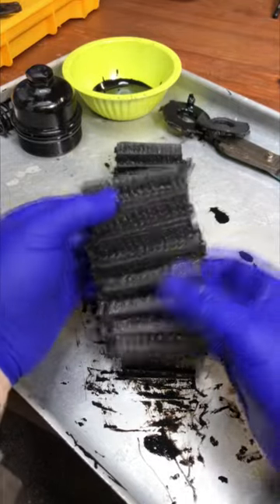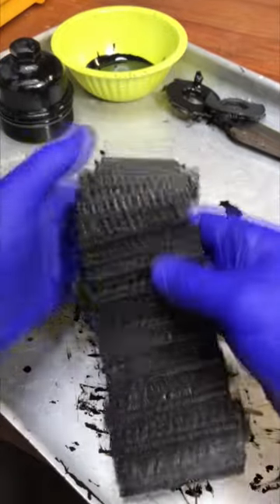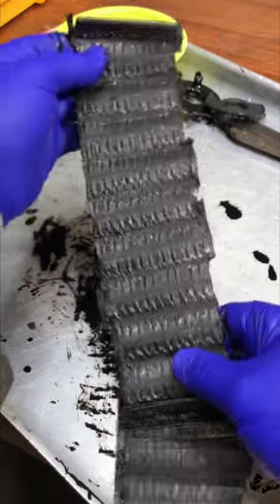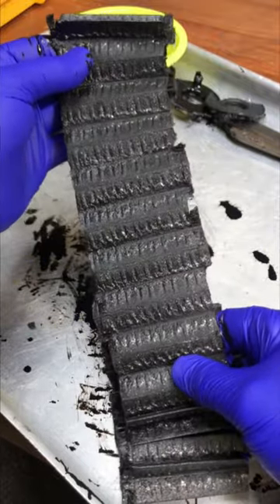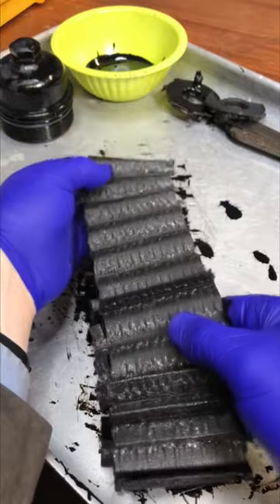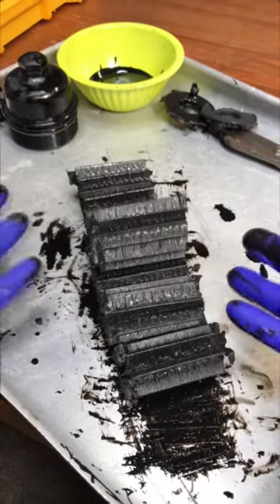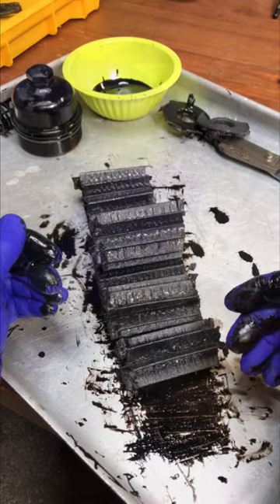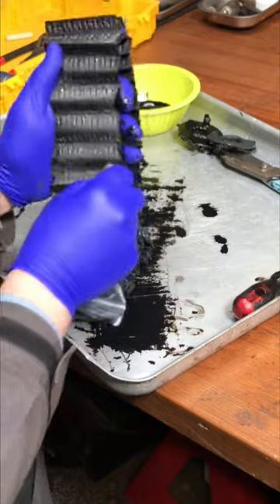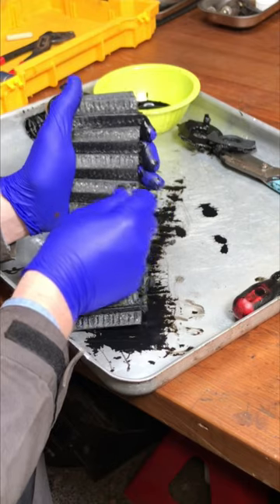This clip was taken from my 2009 MINI R56 series, where I had a timing chain rattle. I decided the first thing to do would be to remove the oil filter, open it up, and see what we got. As you can see, we've got a fair bit of metallic filings. I ran a magnet over to pick up some of those.